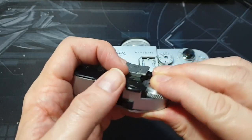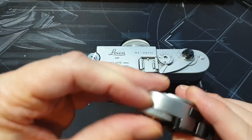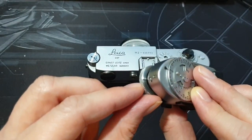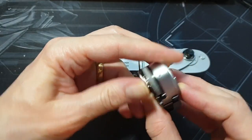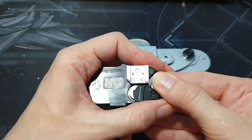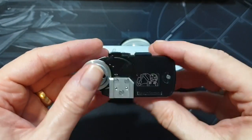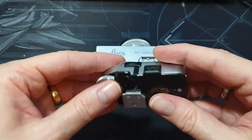That's kind of because this wheel is in the way. If you push that down — it's a bit tricky — push the wheel down, which will only let you depress it if it's turned all the way so that line lines up with that line there. Those both line up, and you can push that in. When you push that in, it gives the cover of the battery chamber enough space to slide past. There's a little guide there but it doesn't tell you that if it isn't pushed up, you risk buckling it.